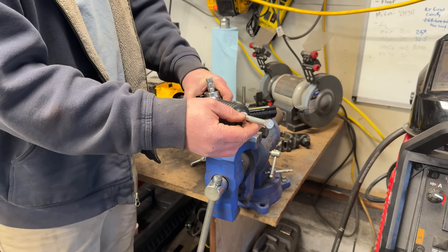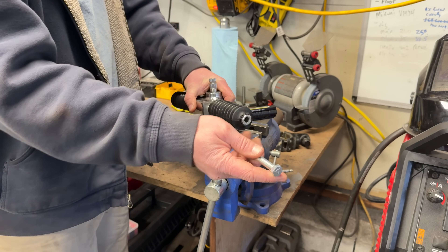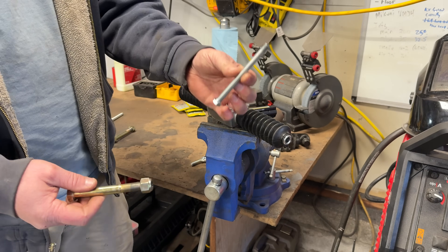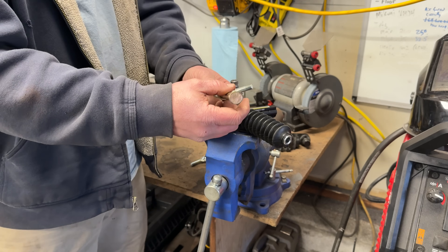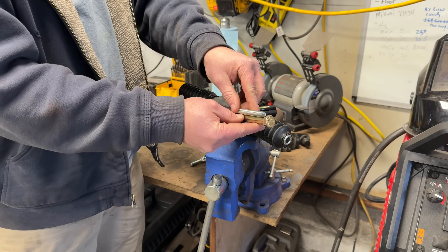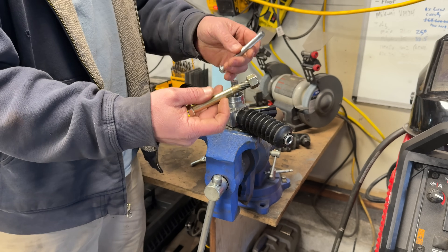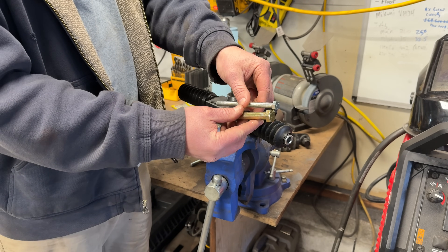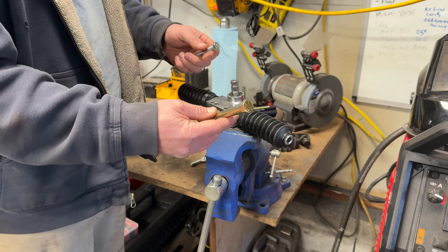You could find some extremely hard bolts to use in here, or you can just use a bigger bolt. The breaking strength of the original is around 500 foot-pounds; the breaking strength of this larger bolt is around a thousand pounds — so you are nearly doubling it by only adding an eighth of an inch. It's a ton stronger and you can just see how much beefier it is.